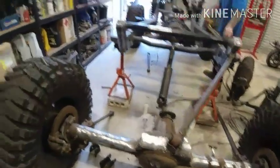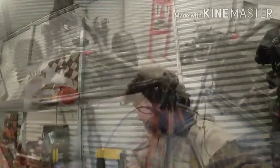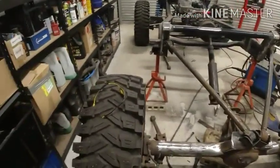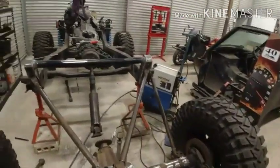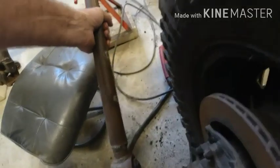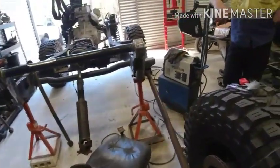Got the other arm there, we're just whipping one up here just to get this in before we go to the pub, but all in all starting to get a bit excited. Obviously you've got to take this plate off, get it all welded up, welded all in, then we can weld it to the diff. I think our measurements are right people — I think we've got this one. It's late on a Friday night and finally got it all in there, well excluding that one. The whole purpose is so we can put these control arms on top to get our 10 degrees of angle going down there, so the recipe tells us. So that's what we're going to continue to do.